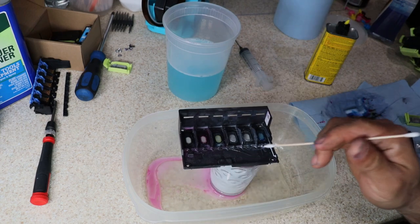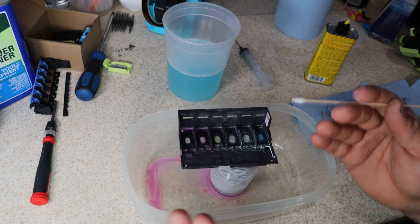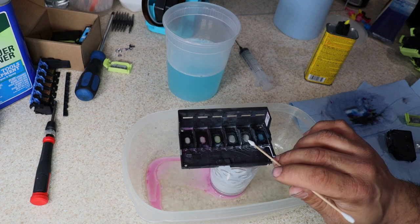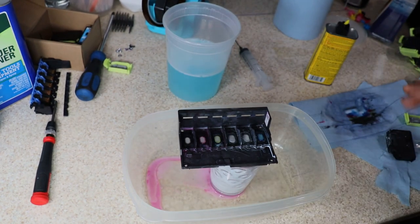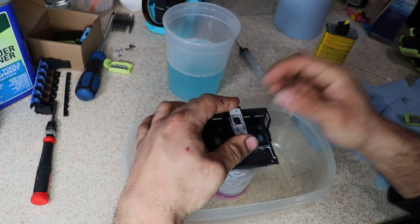What I noticed is that clogs on the glass portion of the printhead are easy to get because you can just clean them right there on top. But most of the time the clog is literally underneath this mesh. This little mesh under it — there'll be the clog, and those clogs are insane. They're really hard to get rid of. I'm going to do one more pass on the gray.